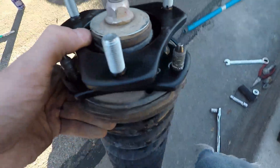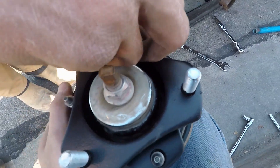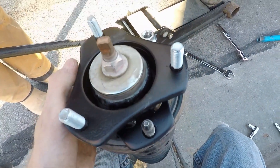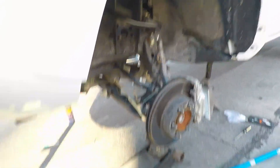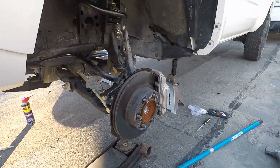Got the shock out. You put the spacer on top — there's the supplied hardware right here. You just throw those on there — lucky door number two — torque them down to 50 foot pounds, and you literally just put it back where it goes, exact same way. Pretty simple.